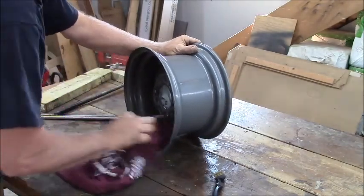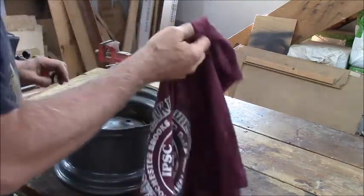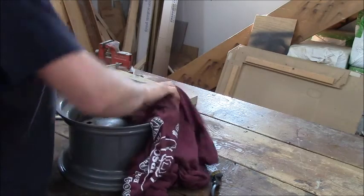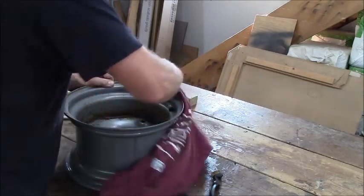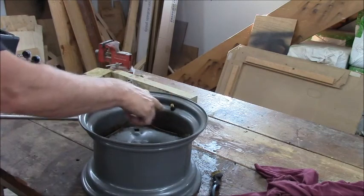If you do a car tire, you have to put it on from the front, because usually the drop center is closest to the front. And that allows you to get the wheel on there, the tire on there, much easier. So I always start with the valve in the back.